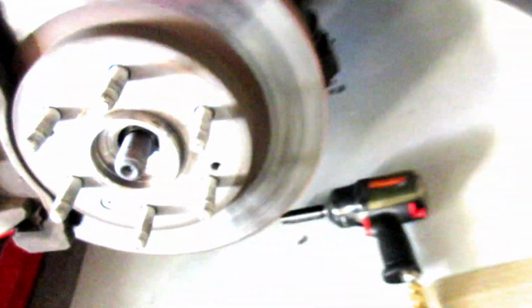This is, I double nutted this end link. It's a 13. If you have a standard end link, like you never changed it, which will probably be rotted by now, you can just sneak this thing out. But these have a fatter sleeve, the aftermarket ones. It doesn't work too well. I'm using 1/2 inch on it. Ooh. Just count the threads when you do this. It's like 20 threads. And I'm kind of rounding out the bottom bolt with this thing.